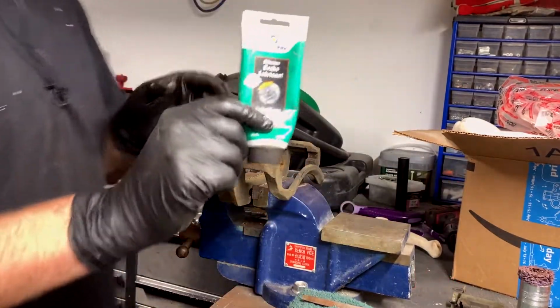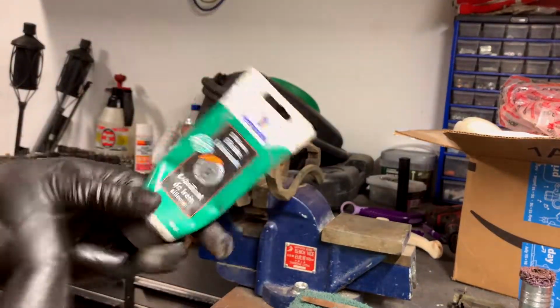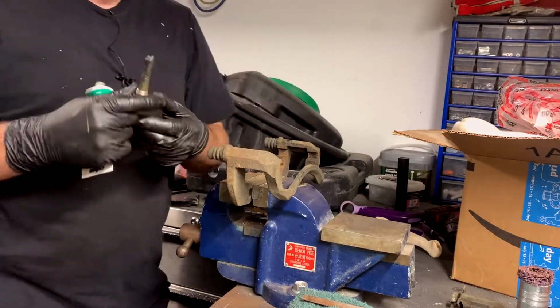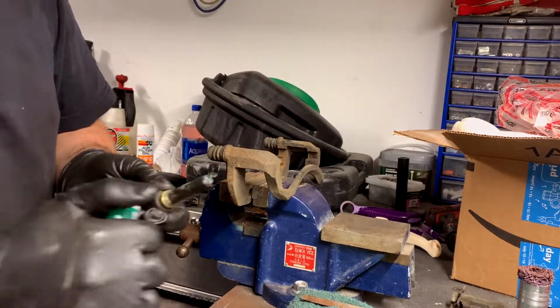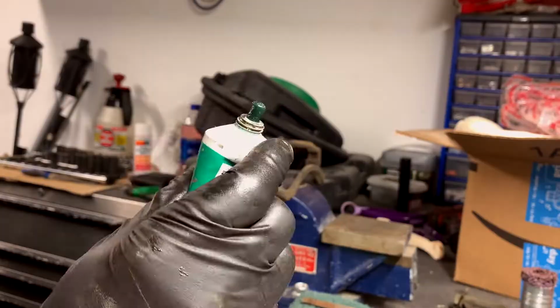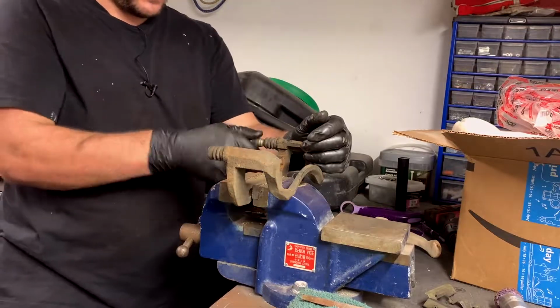Then you want to get yourself one of these or something similar. Not a sponsor, obviously. It's just some silicone brake lube. Pull out your one remaining pin, because the other one's still on the caliper, and just put a little dollop in there. Dollop being like that amount, maybe. And then you're going to want to run this guy in there.